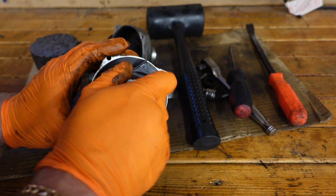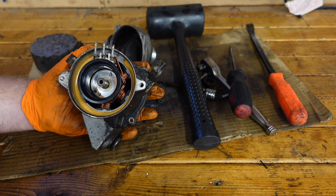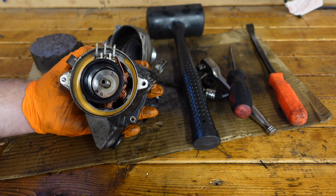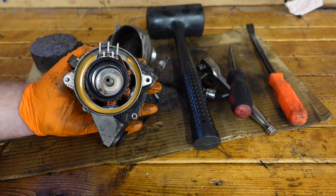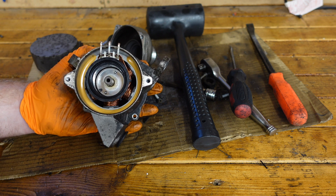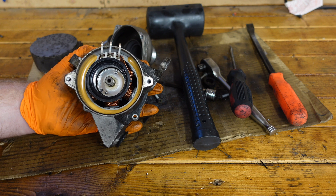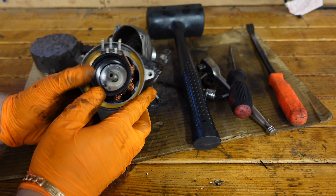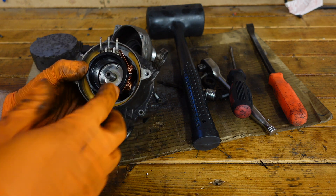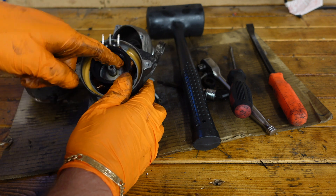You've got the mechanical side of the water pump and the motorized side, which is controlled by the DME — same for the thermostat. The DME controls when it needs to open and what speed it needs to run, which puts less strain on the car. Remember, the M52 had a mechanical water pump where the belt controlled the speed, which would rob you of power — same as when you put the AC on. So electric water pumps are a good design by BMW. I know many of you hate them, but they do work as intended, and they've got a lot better over time — but obviously they are going to fail.